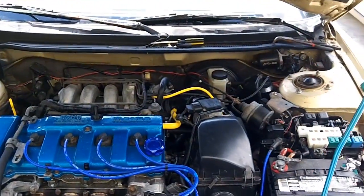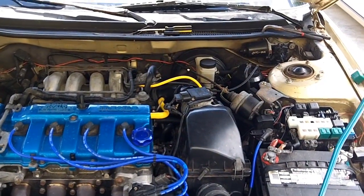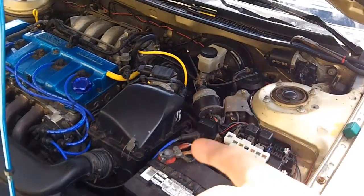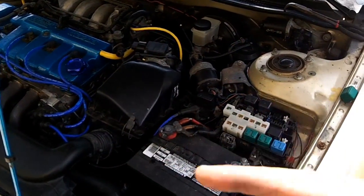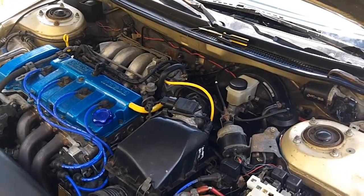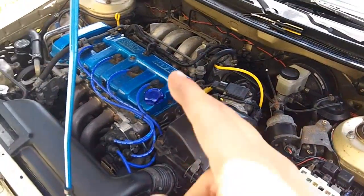The air adjust screw should only be used during the proper circumstances — you should not use it as a fix. It's just a band-aid. In my case, I had a low idle when I had my automatic transmission and the torque converter was messed up. That set a low idle condition, and in order to fix that I took it to the mechanic after the head rebuild.